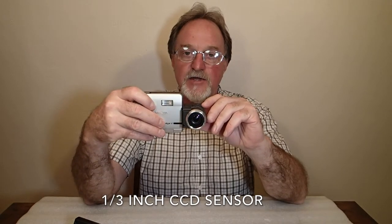It shoots 640x480 JPEGs, 330K images. They're 24 bits deep, so resolution-wise it's really similar to the Apple QuickTake 200. The shutter has a pretty amazing range — it goes from 1/30th of a second to 1/10,000th of a second. The ISO is also fixed; they say approximately 160. So it's fixed and pretty low, which means it needs a good shutter range.